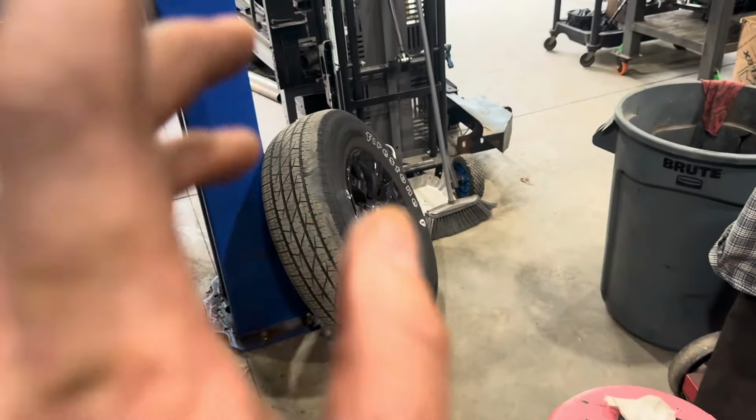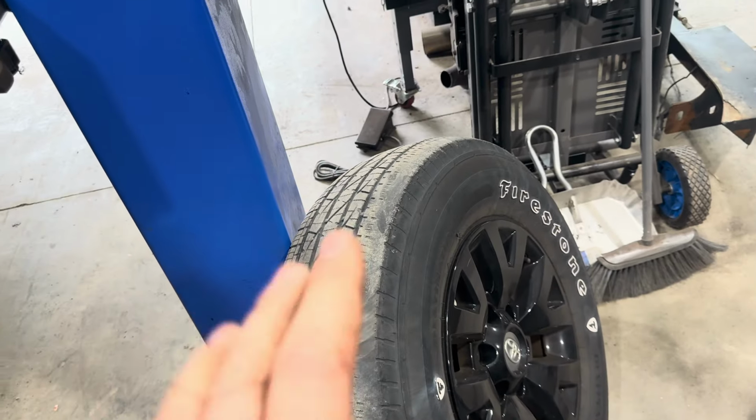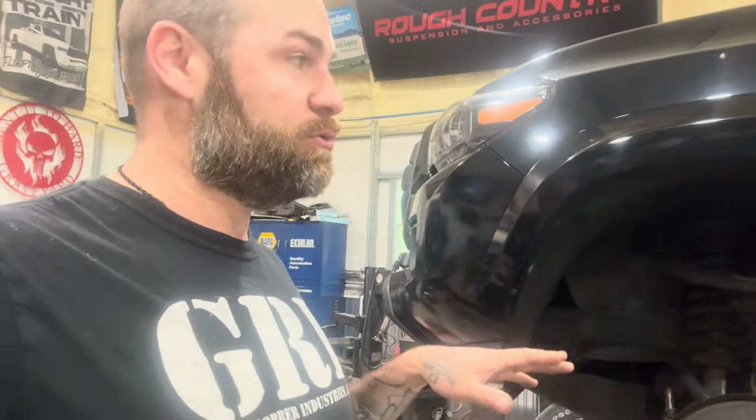All right, talk to the customer. We're a tire distributor. We're going to get a set of Toyo tires for this thing. I can't remember, Toyo Open Country ATs, sorry. And the size, 265/70/16. His factory size is a 245/75/16, real small. He could have gone with the 75 series. It would have been an inch taller, obviously a lot more aggressive tire than what he's got on there, the soft little street tires. But you could get some minor rubbing if you go under like a 2.5 inch lift, and this is just the 2. So he didn't really want to deal with the rubbing. So we went with a 265/70 series, which essentially is the same height as those, but it's a lot more aggressive and a little wider. So it'll still look badass.